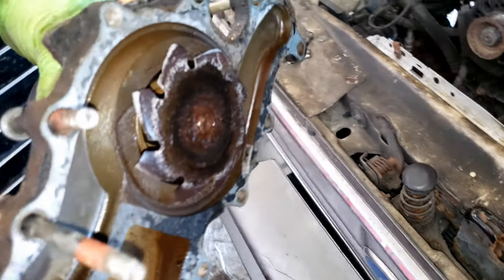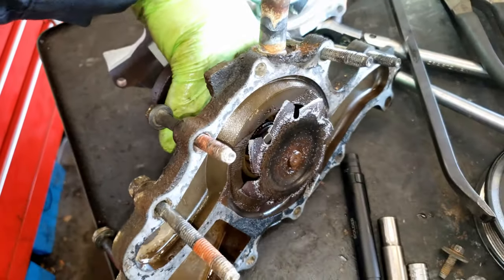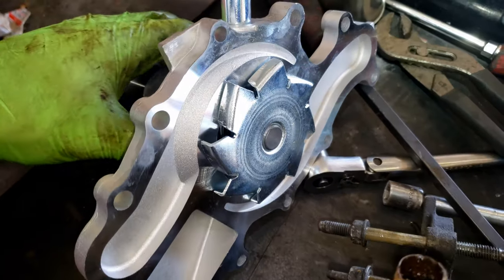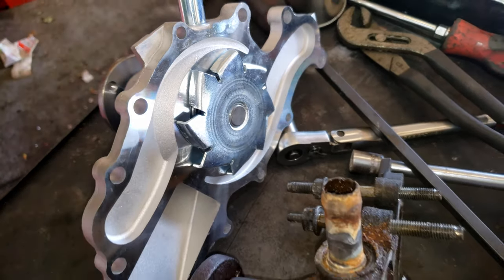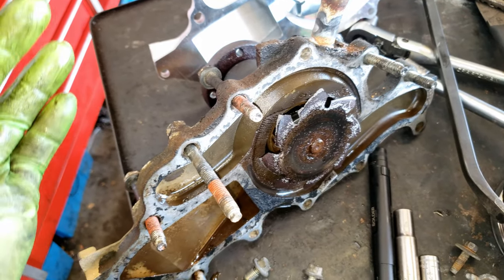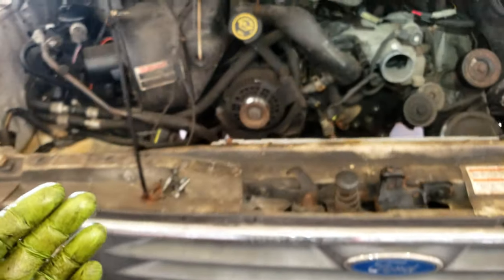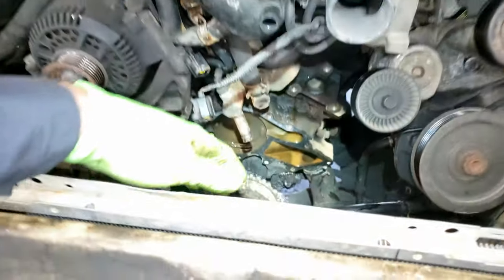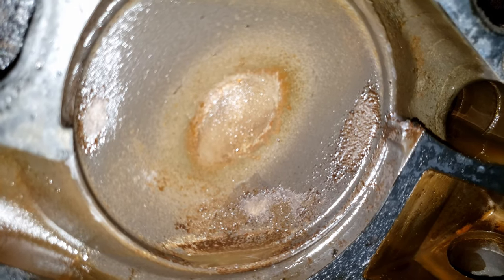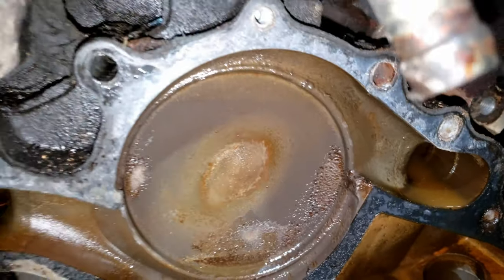Let's see what this looks like — oh yeah, there you go. Diagnosis was correct. That's why this thing was overheating — it wasn't getting any water pump flow. See those fins? They just shredded right off from all the acidity. This is what can happen when you don't change your coolant. You get major acidic coolant and that just rots everything away. So if you have a pump like this, you really want to do a few flushes to get all that acidic coolant out. It even looks like it's etching the metal on the block.